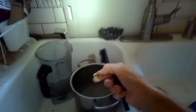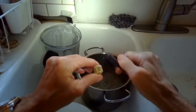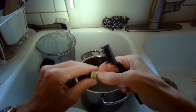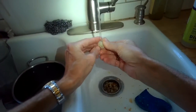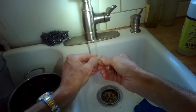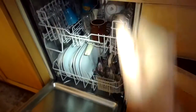So in the time the dishwasher was supposed to let water in, because it was so clogged, not enough water was getting in, and as a result it wasn't activating the heater pressure switch. So it wasn't activating the heater, it wasn't getting hot enough, the soap drawer wasn't opening, and there wasn't really enough water pressure to get up to the upper rack to really clean the things in the upper rack. So by cleaning this off and putting it back in, we may get enough water so that the dishwasher will work. And if not, you can replace the inlet valve pretty easily. I'll put a video link in the description below on how to do that. It only costs about 45 bucks.